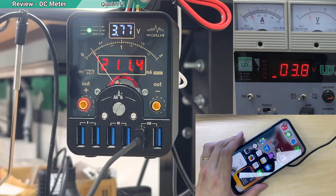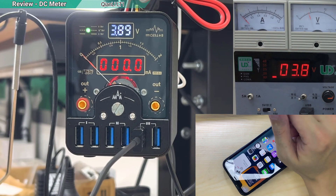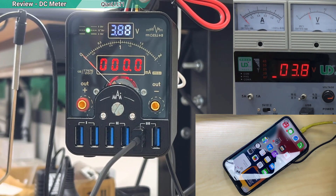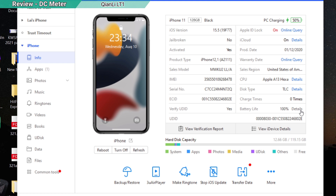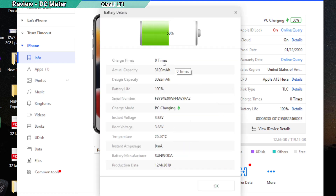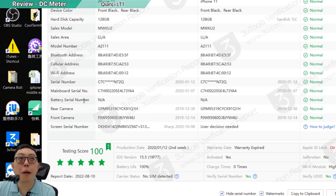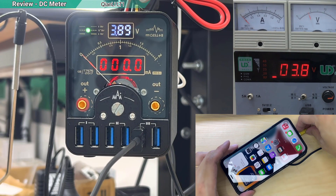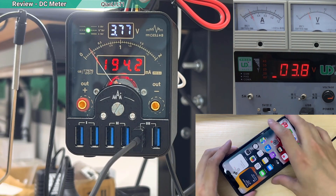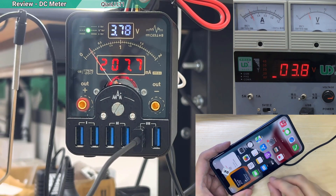The main point is to read the battery by plugging in a cable and reading from the PC. After plugging in the USB cable, the current drops all the way down because it's now using USB current. Reading this iPhone 11, we can see battery life is at 100% — clicking details shows zero charge cycles. The battery serial number shows as MA but still no battery warning message. After a few minutes the phone is very stable and doesn't restart at all, so it can literally run like this for a whole day unless there's another problem.